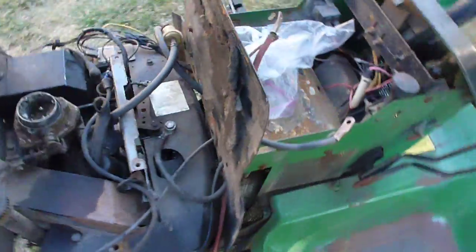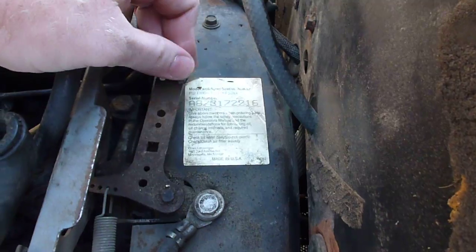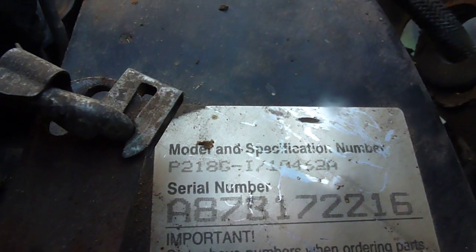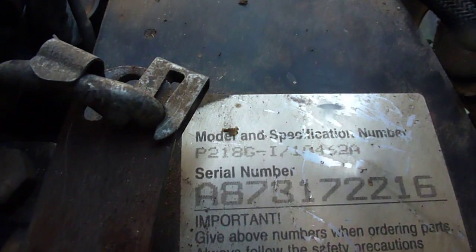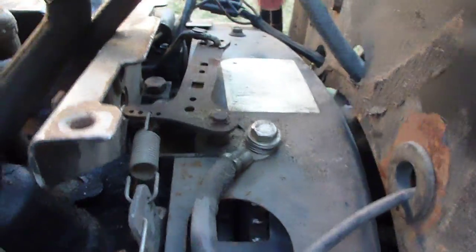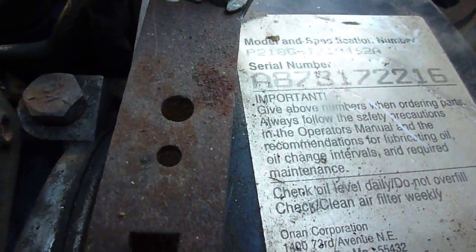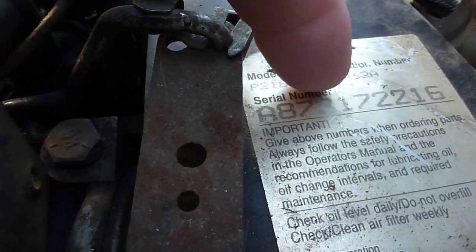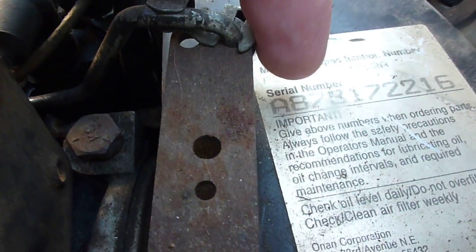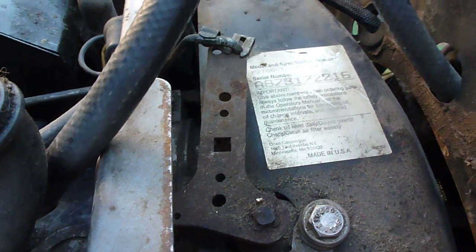Most of my experience lies with these P218s. If we look at the tag on this one, it says P218G, and at the very end it says 'A' — that's because this is a Spec A engine, so this was one of the first P218 series off the line. You can tell it's a 1987 because it says '87' right here. I believe these other numbers indicate the date, and then there's the serial number — we'll have to investigate that.